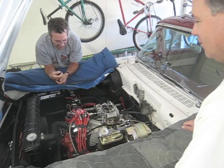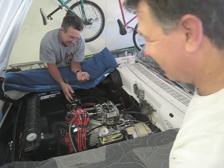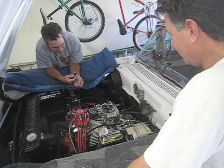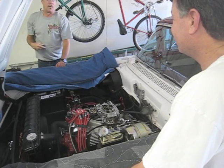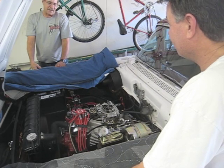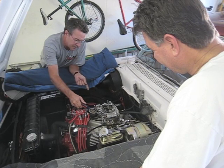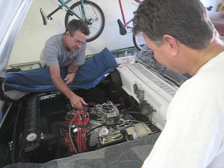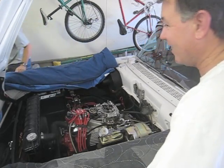What was that laugh for? It just seemed like it's better already. It doesn't seem all bad — I like that kind of laugh. Man, it's kind of sensitive. I wish I had a tachometer. That's running at about 950. Let's see what happens if I choke it down a little bit — keep the idle down. But now it isn't running so snug. Let me play with that a little bit, maybe I can make up for it on the idle speed. That's not the radical cam that we put in there?